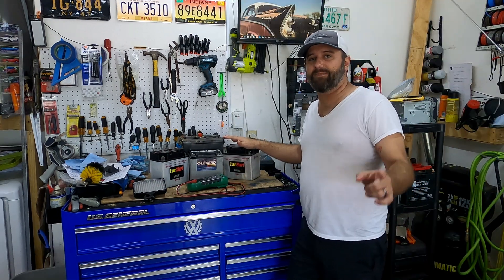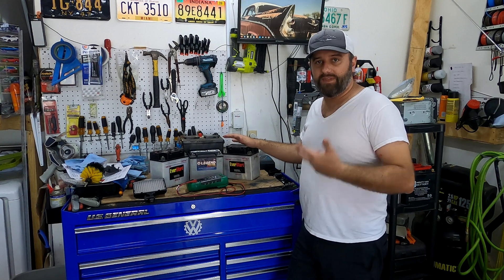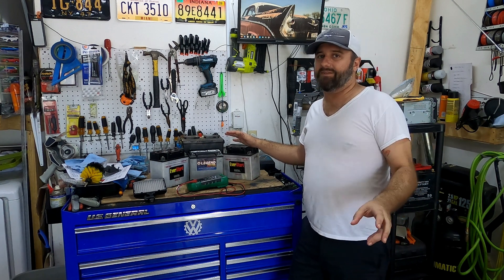Final verdict on the battery desulfator. In total, six batteries - including the Blazer and the Audi - I ran the same process on: charge them up as much as possible, then run them through the repair cycle a couple of times. The Blazer improved but it's still not doing great. The surprising result was the Audi - a more premium battery to begin with but much older - and it still starts up after sitting for over a week after three repair cycles. I'm going to call both the Audi and the Blazer a success. I think I might have a small power draw drain somewhere that's helping kill the Blazer battery, but it's definitely better than it was before.